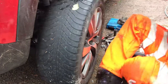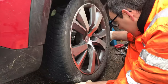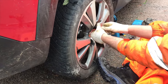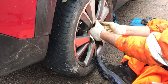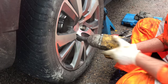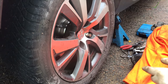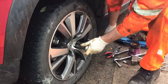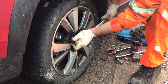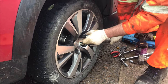Just put the wheel back on, and obviously you want to double check all your handbrake and stuff is still operating as expected. Never tighten these things down with an impact gun — just snug them down and then torque them down. Drop it on the ground now. 100 newton metres. I know a lot of people don't bother to torque down the locking wheel nut but it's bad practice to leave it just hand tight. The amount of them I find loose on the road is crazy.